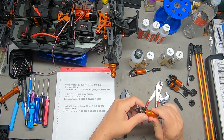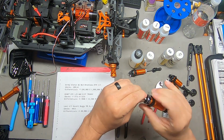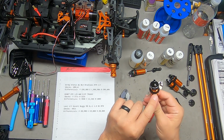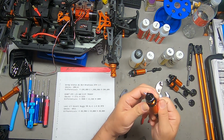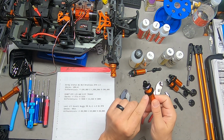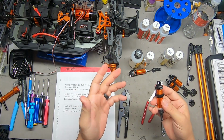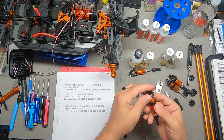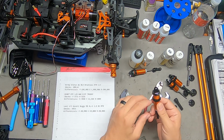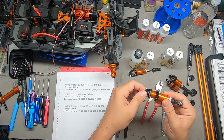You're going to want to have a wrench handy. These caps are on pretty tight, and they did put O-rings in the preload adjusters. Unlike the DBX-10, my DBX-10 did not have O-rings in the grooves inside these. Whoever assembled it either left them out, or I don't know, but they were not there. These not only seem to fit better and are properly, you know, the threads are the right size for each of the two components, but they have the O-rings.